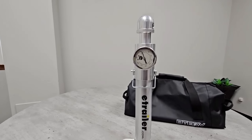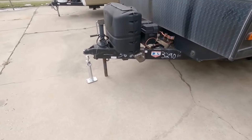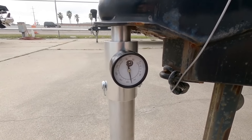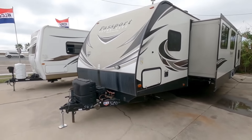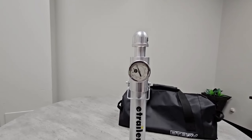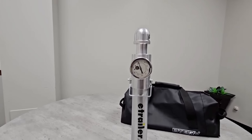This permits you to specifically see how much tongue weight is resting on the back of your vehicle. When I got this from the folks over at eTrailer, I went out to an RV dealership and we played a guessing game to see how much tongue weight was transferring to the tongue of travel trailers — about 12 different RVs. The interesting thing was it was typically much more weight than you thought. Even though we want 10% or at max 15%, some of these RVs had 15% or more tongue weight being transferred before you even loaded them up, basically off the RV dealership lot.